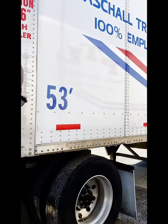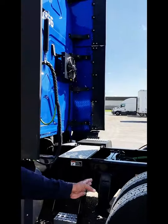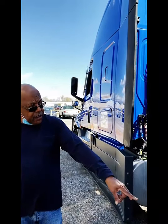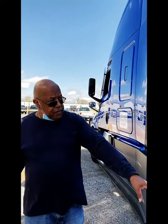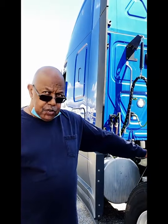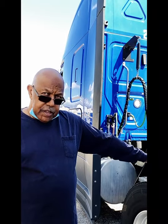I'm in good position. Let me show you how I decided to be in this position. My outside rear drive tire is lined up with the nose of the trailer and the landing gear, and it centers my fifth wheel with the kingpin. Now I'm going to back up.